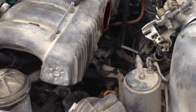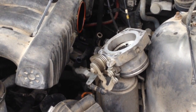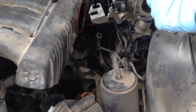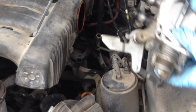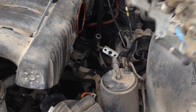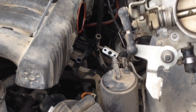We're back and all we've done is take two bolts out of the bottom bracket and pop it off. You can see the third hose right there we just popped off - there's no clamp on it. You can see the two holes that hold the throttle cable bracket in, and those are 10 millimeters. So now the throttle body is completely off - this will be for sale too.